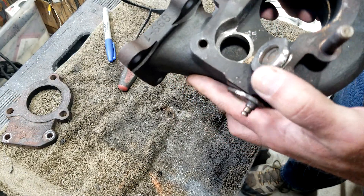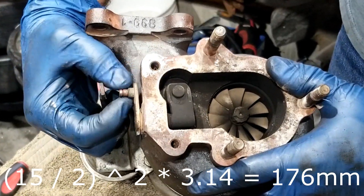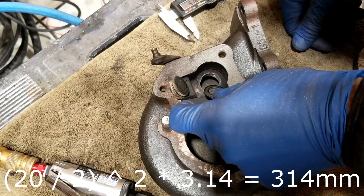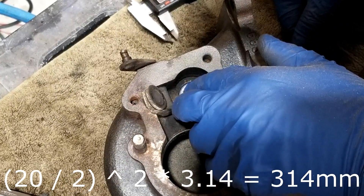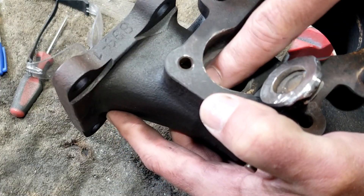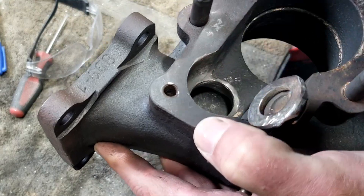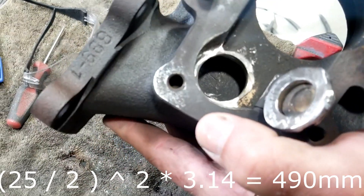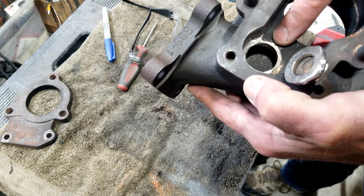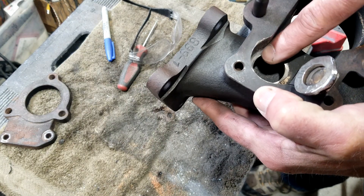That's quite a bit of work — takes some patience. This started out as a 15 millimeter diameter hole, which means about 175 square millimeters of open area. I bored it out to a 20 millimeter hole, giving it closer to 300 square millimeters of opening. After thinking about that overnight, I decided I wanted to go bigger. So I cut that washer back off and bored this out to just a little bit over 25 millimeters. It's a little conical, so it's more open toward the inside of the runner. That gives us about 500 square millimeters of opening — from stock 175, to 300, to now 500, which is about three times the size of the original hole in area. Presumably that equates to three times the flow.